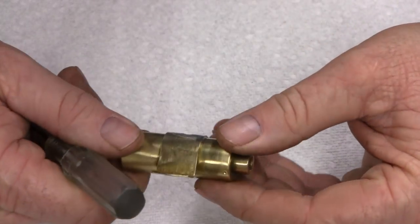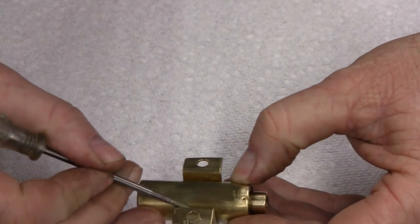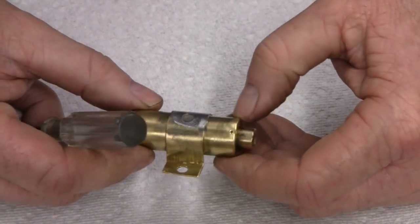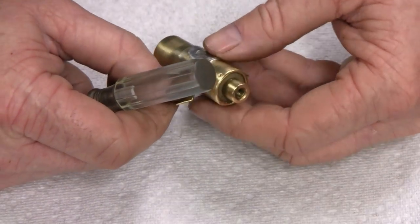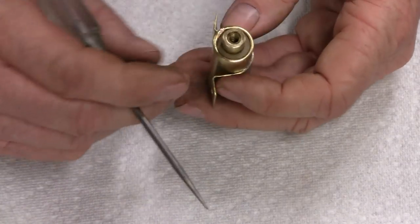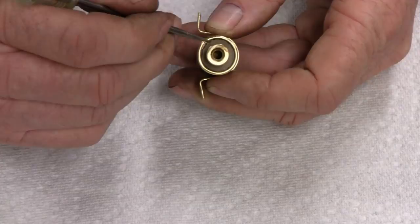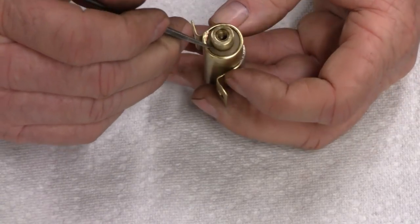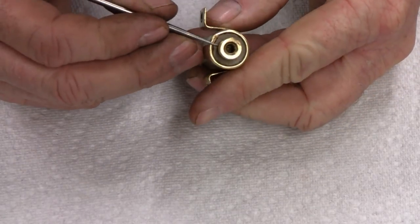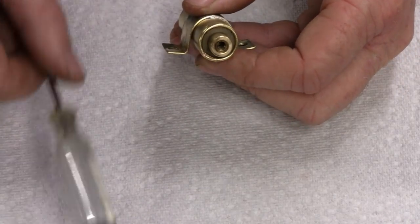So there's two ways I was looking at this. There's two ways we could have done this. We could have desoldered this and taken this clip off, and then just cut this in the middle. That way, when you put it together and you put that back on, you never would have seen it. Oh, let me move over here. Sorry about that. But this one here, I don't know if you can see it, but this has like 4 little dimples. And what happened is they put this together and then rounded the edge off here. So when they put that in there and rounded the edge off, that sort of held it in place. So I think I'm just going to cut this rounded edge off, because you'll never see it, and then just pull the guts out that way. So, alright, let me get my Dremel and we'll cut that little rolled edge off.